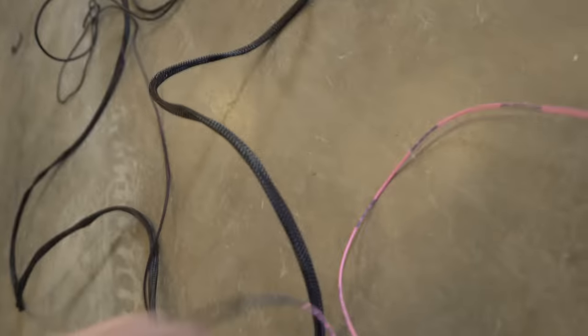The compressor is connected to the air tank. Now I'm setting up the manifold roughly where I want it. The water trap sits between the air tank and the manifold — the last thing you want is water in your manifold, which is why it's included. I need to mount the water trap, then run a line from the tank to it, and another line from the water trap to the manifold. Next I'll run the lines going to the front bags.